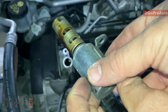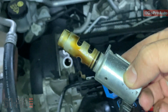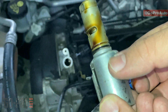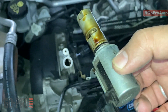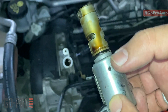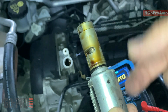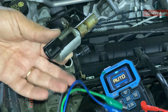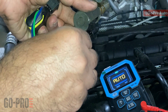This is the solenoid valve — it's not that dirty; what you see is just engine oil. But sometimes when you take it out you'll see oily sludge all around it, which must be completely cleaned. After removing and cleaning, since we already checked the internal resistance, we want to make sure the solenoid actually works. Checking resistance alone doesn't confirm it — we want to make sure it generates enough magnetic field to move the plunger inside, and that the plunger isn't mechanically stuck. I'll use a 9-volt battery, which is much safer.